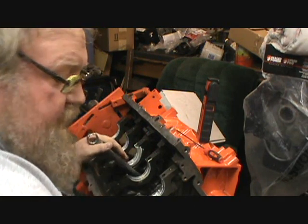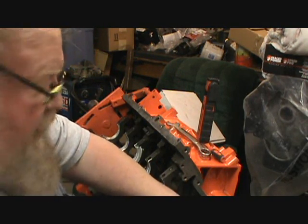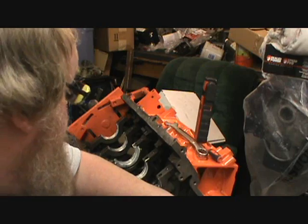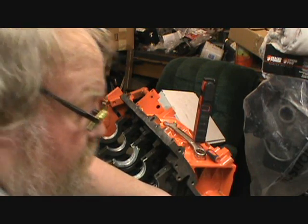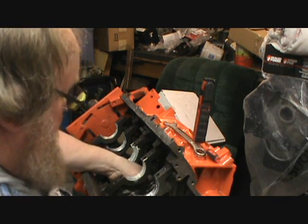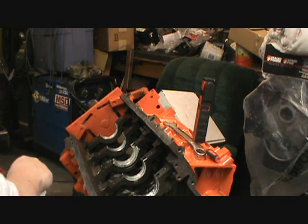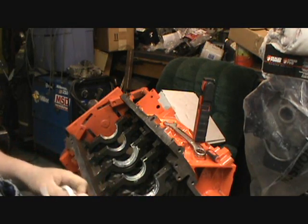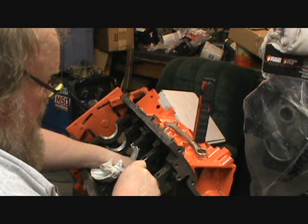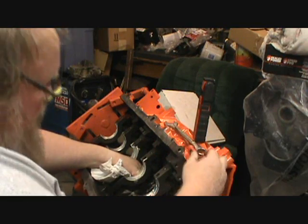You know, a lot of guys don't like driving their own cam bearings, and I love doing this part of it. I love driving in the cam bearings, except for when they don't fit right. And the other thing I don't like is that to put the front one in, you got to come in from the back of the block. I've tried over the years. I've had some success just driving that one in, but I usually end up setting up and doing it. Yep, there we go. Got plenty of room on both sides of the hole, so it's in there.